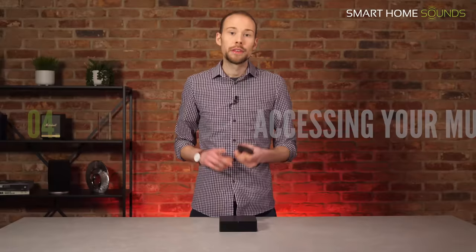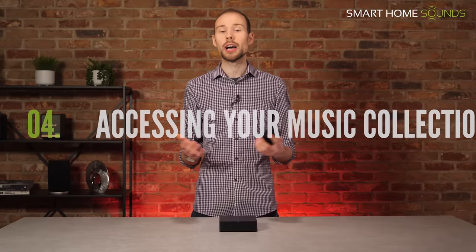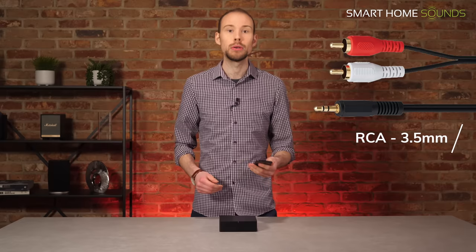The final scenario that I can think of is if you have an old device that has lots of music stored on it, like an iPod, a phone, or even a PC. As long as that device has a headphone jack on it, you can use an RCA to 3.5mm cable to connect it to the port and start playing any music on the equipment that the port is connected to, as well as stream to any other Sonos speakers in your home.